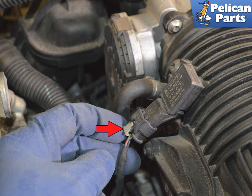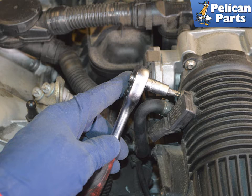On the air intake pipe, slide back the gray tab and then press down on it and separate the electrical connection. This sensor is held in place with a T30 Torx. Use a T30 Torx and remove the single screw, then remove the sensor from the mount.